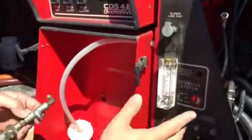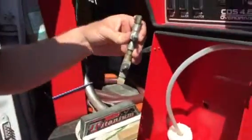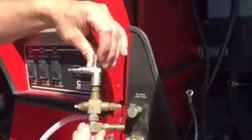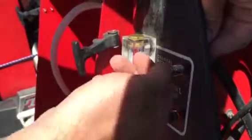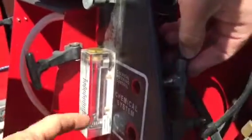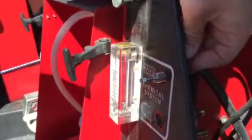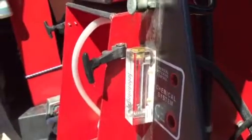It hasn't been metering correctly, so we've got to have the right amount of chemical. This valve goes through the panel and is bolted on. You've got your prime position and your on position that lets the stuff go through, and you've also got this adjustment knob that controls the amount going through. This is the detergent that meters into our steam, and that's what makes our carpet machine really special — we can control how much actual chemical is going into the carpet.